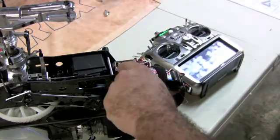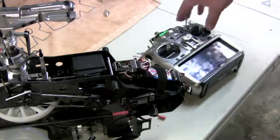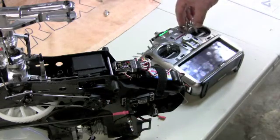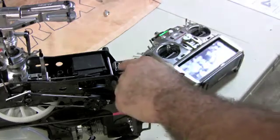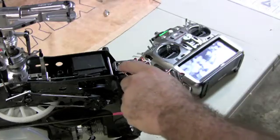At this point we are going to go from the direction we know is correct, go to elevator limit, hold your stick forward for a second, then release. The next light would indicate if we needed to reverse the direction of the gyros for the aileron or elevator — which we don't, we're good.